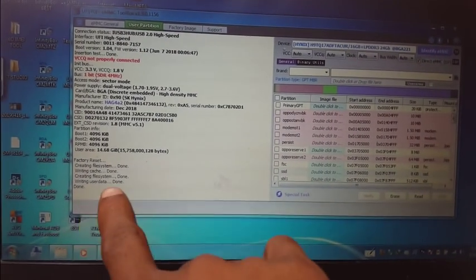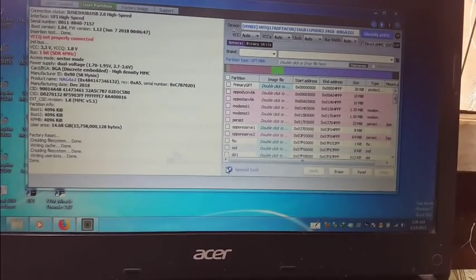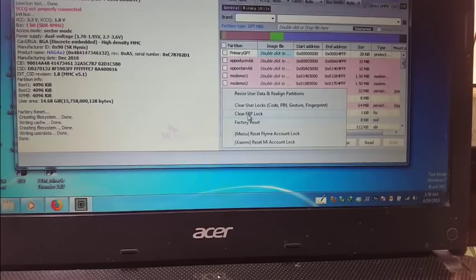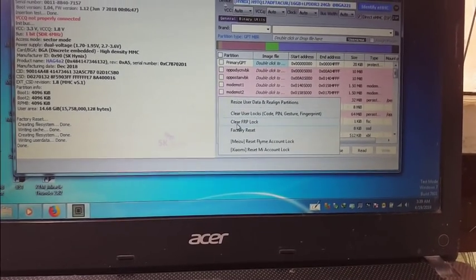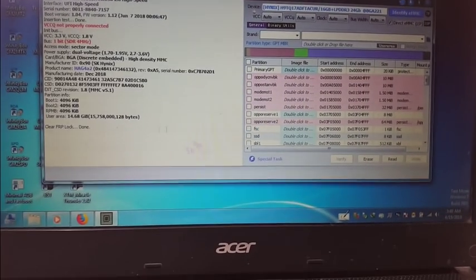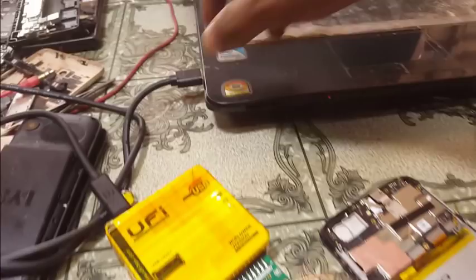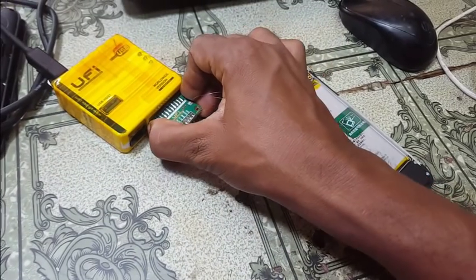Okay, when you see writing user data done, simply click again, special task, okay? And here you can see clear FRP lock. Okay guys, if you want to save your data, just click here, clear user lock, okay? Clear FRP lock and just wait. Yes, clear FRP lock done. Okay, right now you can close UFI software, UFI box, and remove eMMC socket